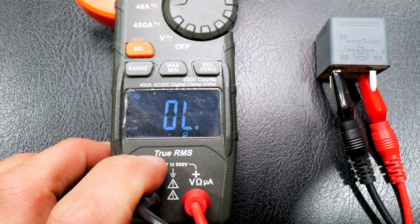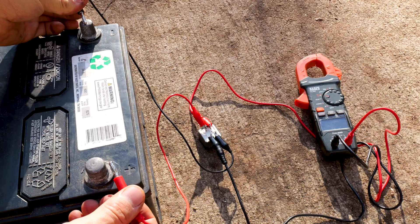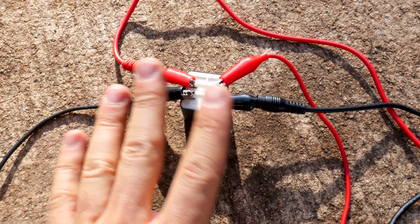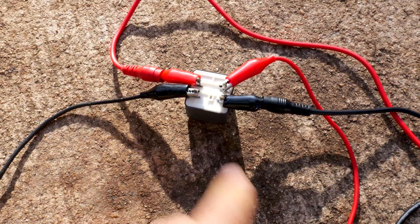So that's it for the video. You don't need a bunch of special tools to test these relays. You can check it with a multimeter, check it with a battery, check it with a power supply. If it clicks on and off — super easy, nice and healthy — then you know the relay is good. Drop me a huge thumbs up down below. Don't forget to subscribe for more mechanic truck tip videos in the future.